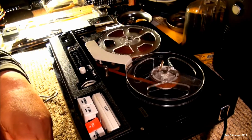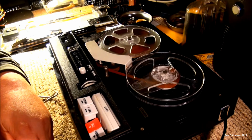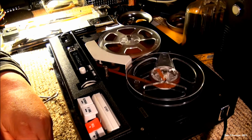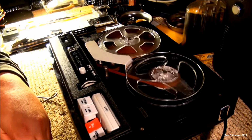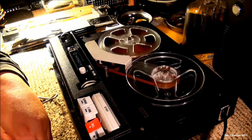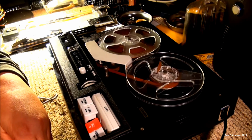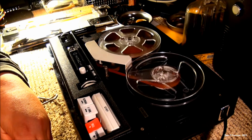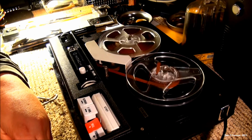Alright, I'm going to try a microphone test of the Hitachi TRQ-520 5-inch reel-to-reel tape recorder from, I think, 1967. It has AC bias recording. This unit performs okay, as near as I can tell, in playback and fast forward. I just got it at the estate sale. It even had fairly new batteries in it, not all of them, and they're combining carbon zinc with alkaline, but it worked. But what does not work is the rewind, and as near as I can tell, there's a broken spring somewhere under the idler wheel, which at this point is beyond my repair capabilities. So until I can figure out how to fix that, this is a playback unit only. Well, let's rewind this and see what happens.